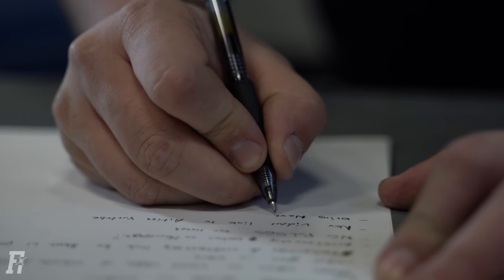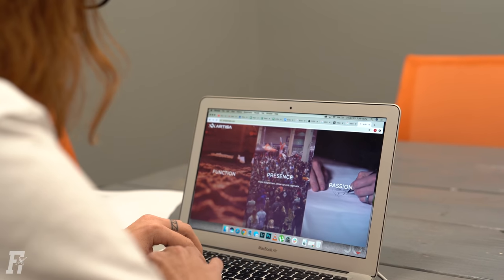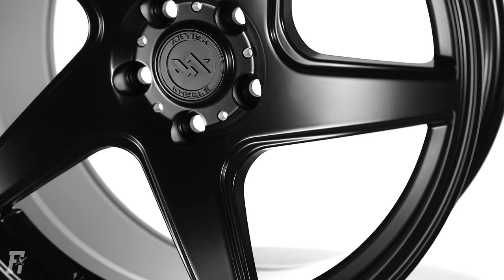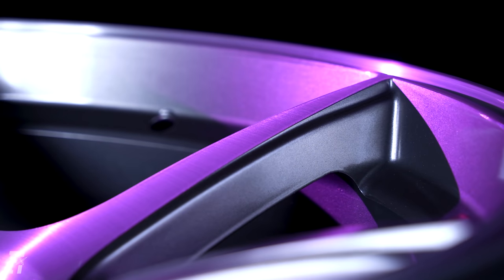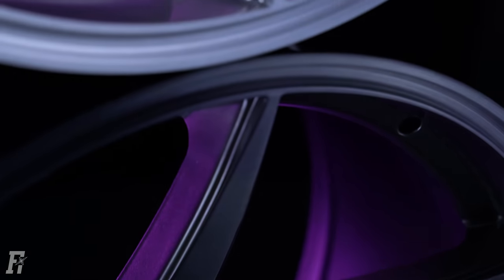These conversations fueled Artisa's design work, our colors, our brushing, the techniques, and the technical foundations of every single wheel we went to launch with. All of these details were carefully crafted around maximizing function, presence, and passion, and would bleed into two of the biggest pieces that make Artisa wheels what it is: Artform Technology and Deco Directional. Artform Technology covers our hyper-thin flow-forged barrel, which ends up being less than three millimeters wide while maintaining an above OE load rating. Backpad, spoke, and barrel shaving wherever possible reduces unnecessary rotational mass without sacrificing front design and spoke angles, maximizing concavity for big brake clearance. Our adaptation of the A356 aluminum alloy paired with the grain restructure of the barrel provides forged-like weight savings and strength.